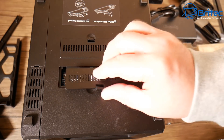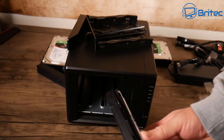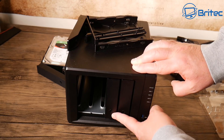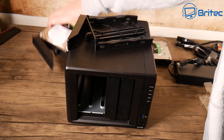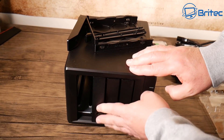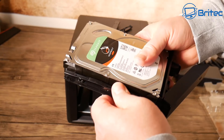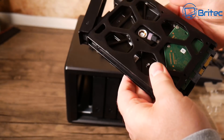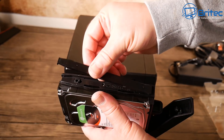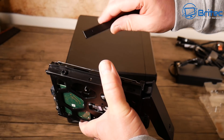Let's put the cover back on and install the drives. I've got these IronWolf drives here — just slotting them into the unit. It's a tool-less design: they slot straight in, push up to the top, and click into position with a locking mechanism. To slot them into their caddies, put the drive in, line up all the holes, and use the fastening strips to click them into position.